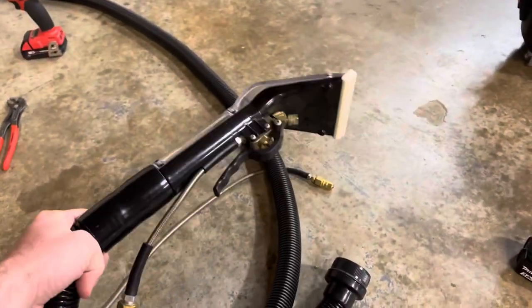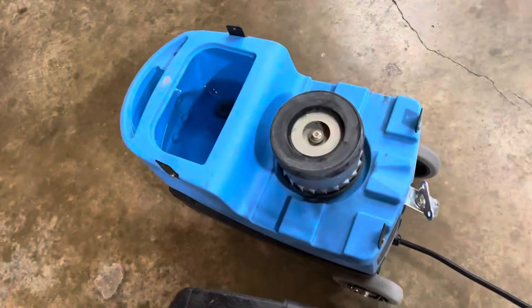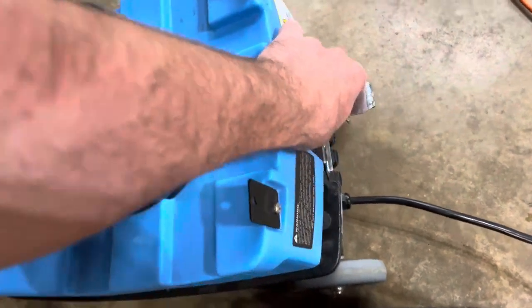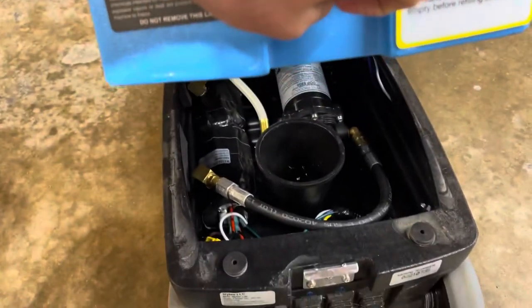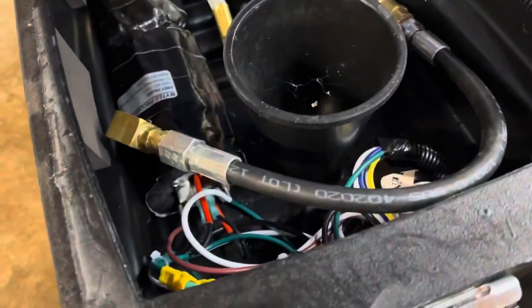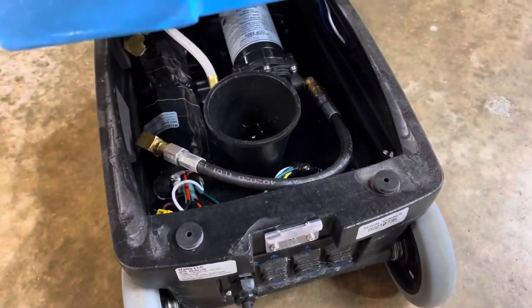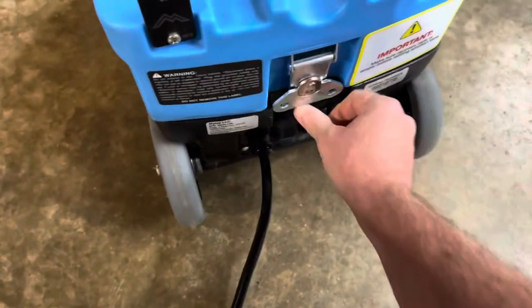The hose is right here. I tried everything. Some of the other videos I watched told me to take the top off, which you really don't need to do. If you unlatch the handle in the back you can get down here. I went in here — there's the pump, there's the heating element. I took the hoses off; I thought maybe it was vapor locked, but it wasn't. I took compressed air and cleaned everything out, hooked everything back up, and still the thing would not work.